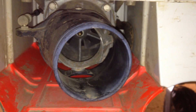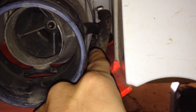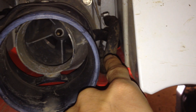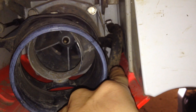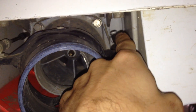Here's a shot of my dirty pump. Everything kind of starts back here. You'll see that looped around hose. On the bottom side — bottom right there — you'll see it dives into the housing. What that does is it allows water, as it's passing through the pump, to be forced into that hose. The hose goes up and goes back into the hull.